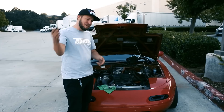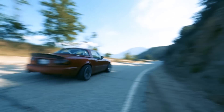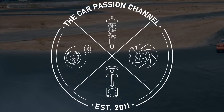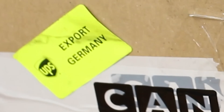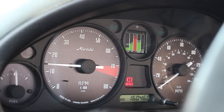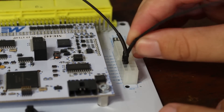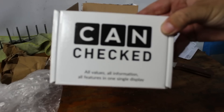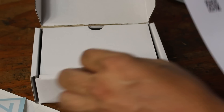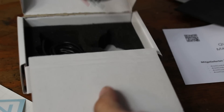The CAN Checked comes all the way from Germany. In a nutshell, this is a multifunction gauge that can display all kinds of information about your engine. It requires minimal wiring, no additional sensors, and connects directly to your standalone ECU with just two wires. This is a special version called the MFA 2.0, which fits directly into your Miata's gauge cluster for a factory look.